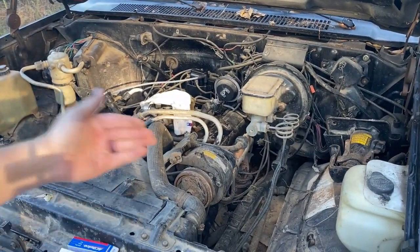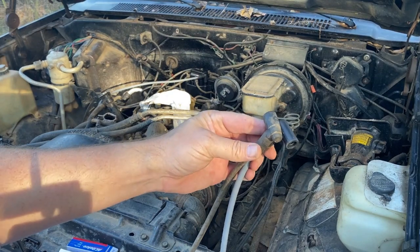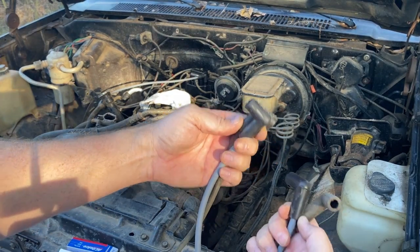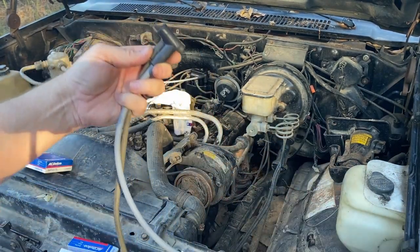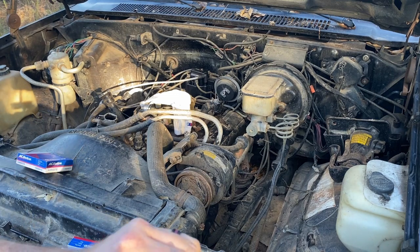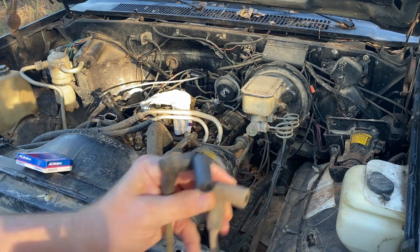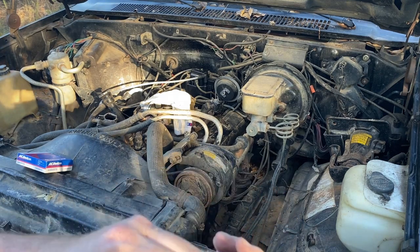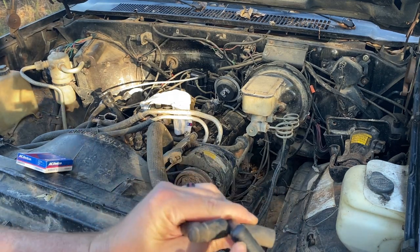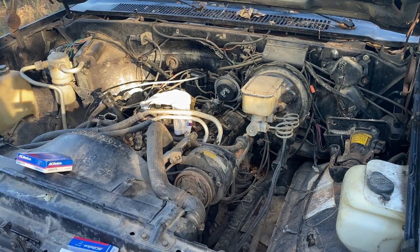I just told y'all about a straight boot, 90 boot. Now, number 4 down there had both 90s. There's 90s on both ends, and I found the piece that had both 90s. So do your best to keep them the same. Does it have? Yes, okay, right here. Since they're both 90s, it says distributor coil. And then this just says KY, whatever, KW, whatever. So that means this is gonna take the place of this one up at the coil.